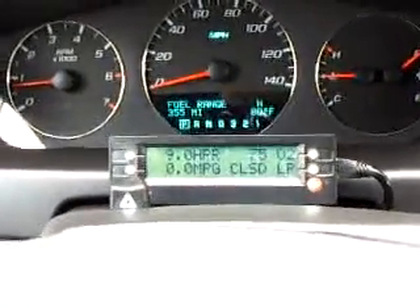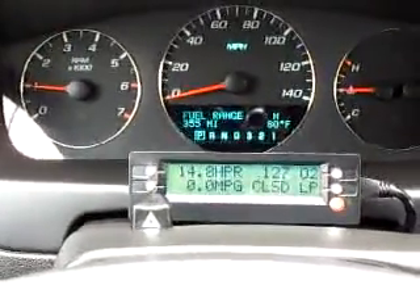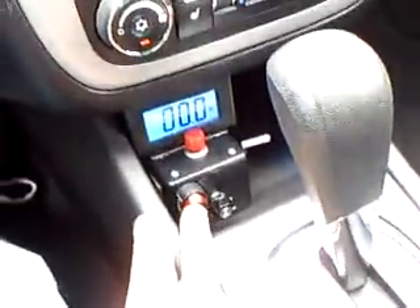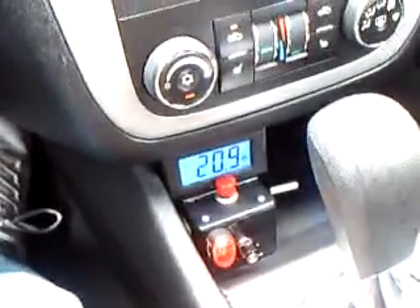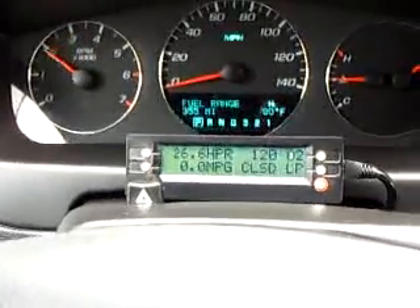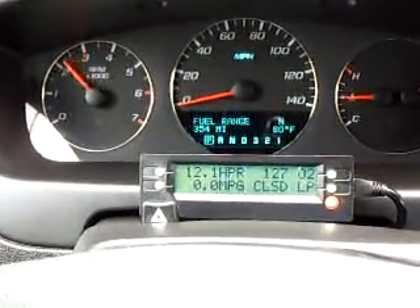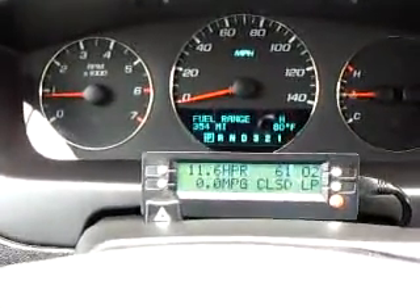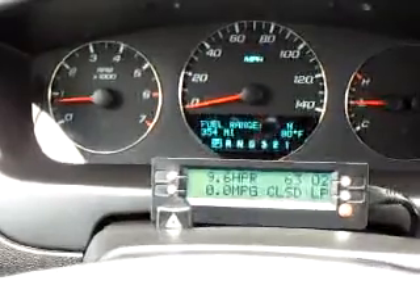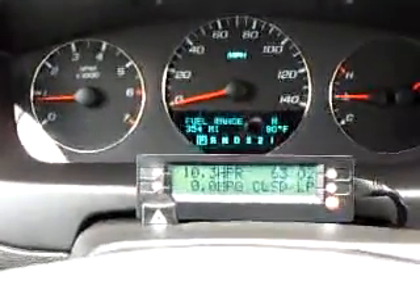When I turn it on — which I'm turning on now — it's about 64 to 63. Rev it up and we get 127; that's a lean reading. Then we turn on the HHO system, introduce the gas, let it go into the line, and see what the O2 sensor detects. It's jumping down. Horsepower is up, then settling down again, but you still get higher values which throws a lean code — which is probably good for me.